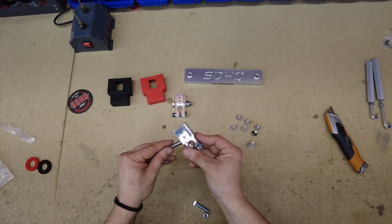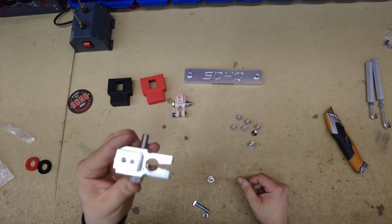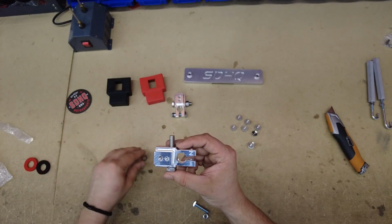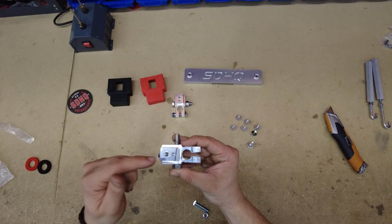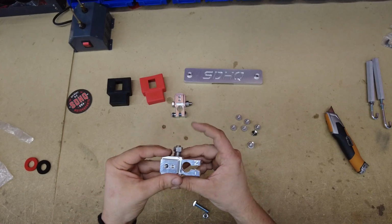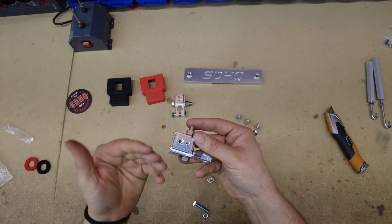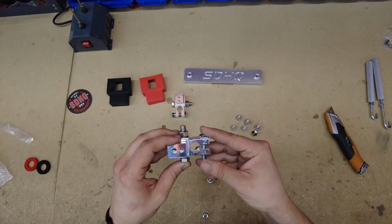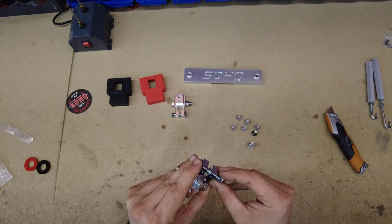The other one we're gonna do the exact same way because this side's a lot closer to the fender skirt, to the inner fender there. And because of that, we won't be able to get this longer bolt out unless it's put in this way. And since this is the ground side, it doesn't matter if it touches the tie down because that's already grounded as it is. And then once again, this side will never come out. So we'll go ahead and run it from this direction.